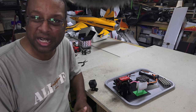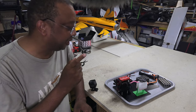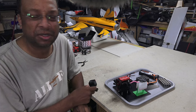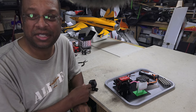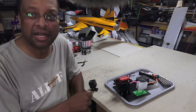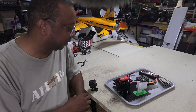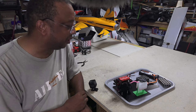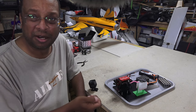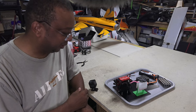I was a little worried at the beginning, but the factory setting on the carb was way off — it said two turns out but it was at about five or six turns, way out of whack. Turning it all the way in and backing out two turns was a good starting point. It looks like it's easy to flood the engine, so you have to be careful. If you think you've flooded it, unplug the hose and run it a bit to clean it out, then plug it back in and it runs great.